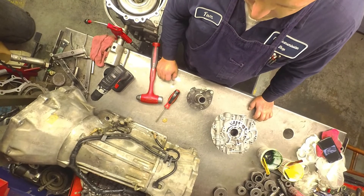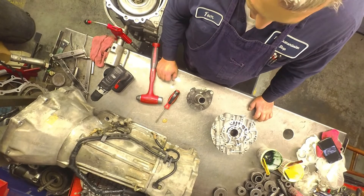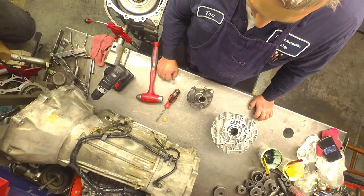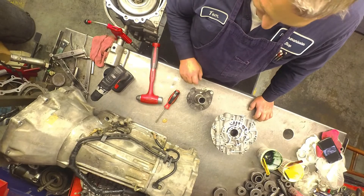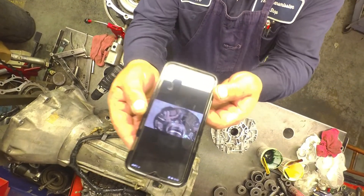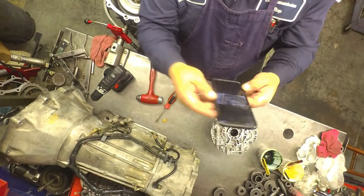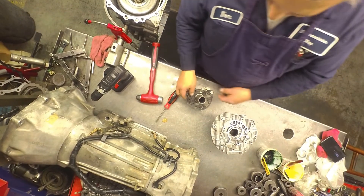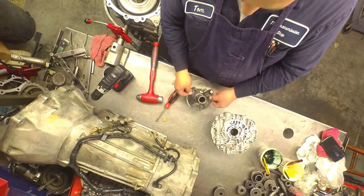It smoked the 1-2-3-4s, the 3-5s reverse, and the 4-5-6s again. I took it back apart, got new clutches, put them in, and started air checking everything. It had a really massive leak — it was this gasket right here. So be sure to make sure this is flat and that you replace this gasket.